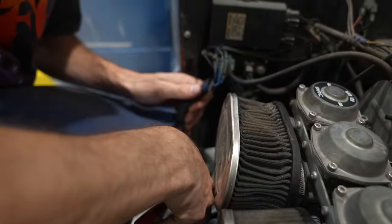Sick. I'm so hyped up on this CDI box setup. FDF tie rods. Yamaha motor. Did you put FDF tie rods on it? Yeah, they were smoked. Did you just drill another hole in the knuckle, or what'd you do? No, I didn't do any angle mods yet. I haven't even driven the car. Typically, you just drill another hole in the knuckle for this kind of stuff. So I was gonna do that, but then I was gonna make a spacer to move the spring up, because the spring is like the point of contact in the front. So the tie rods will hit the springs.